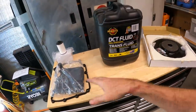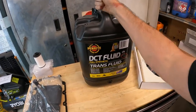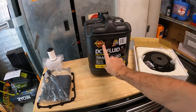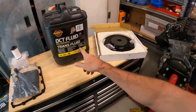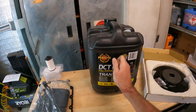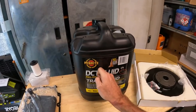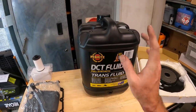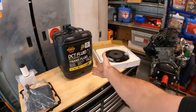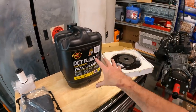While I'm standing here, something else I'm going to do while the gearbox is out — obviously you need DCT fluid. I'm going to go with the Penrite fluid. I've used Penrite transmission fluid in my 6AT, which is making over 600 wheel horsepower. The Penrite BMV for ZF transmissions works quite well, and this is supposed to be fine with the ZF DCTs. It's untested — I don't know anyone running Penrite with the DCT — but we'll see if I have any problems with clutch slip.